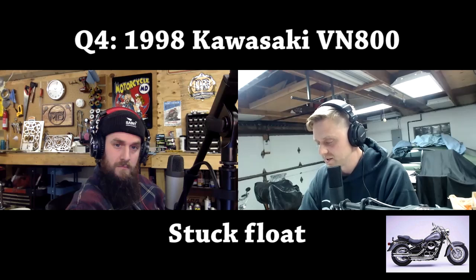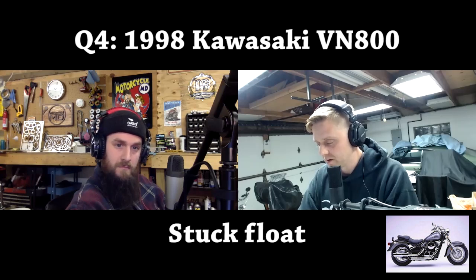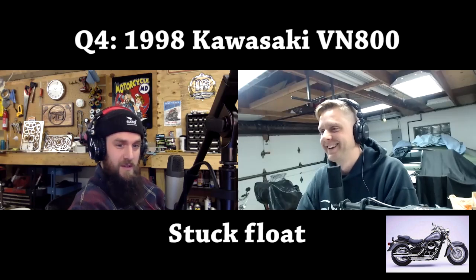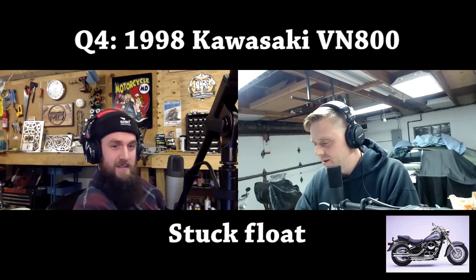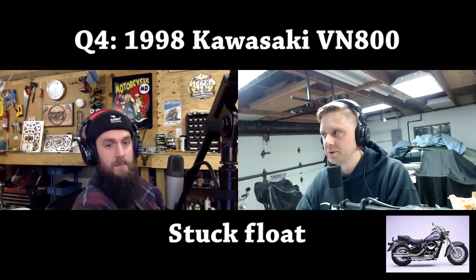So what you need to do is obviously drain the oil, change the oil, pull the carb, fully rebuild the carb, clean it, and then you'll be back good as new. Yeah, take the spark plugs out. Make sure your friend's looking right down the spark plug hole and then turn it through. With safety glasses, of course. So that thud clank you heard, there was probably a lot of fuel in the cylinders and you're trying to turn it over and, you know, fluids do not compress.